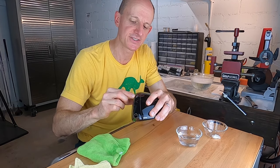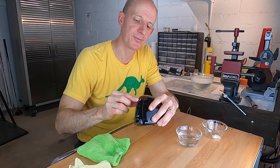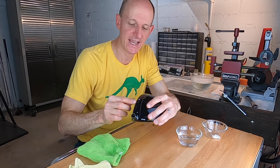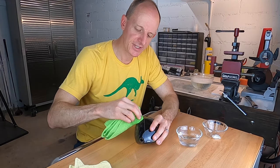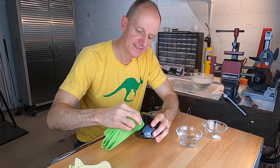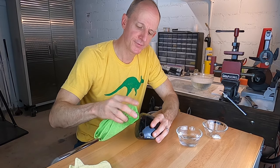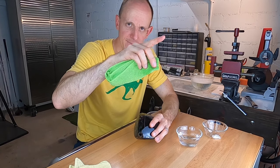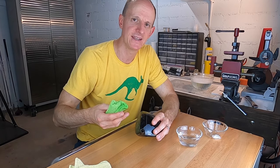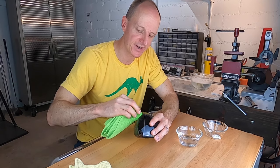We've got a big pop-up mark right here, but it doesn't look like it actually scratched into the paint — it just sort of rubbed the clear coat, which should be a good section we can hopefully clean up. Over here we've got darker scratches — probably not going to be able to get those out completely, but we may be able to lessen their appearance. When we get to spots with deeper scratches, I'll push down a little bit harder and see if we can smooth those out. Basically we're trying to rub down the clear coat a little bit where it's been bruised or scratched.